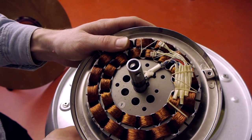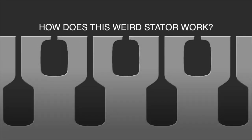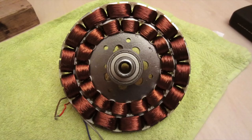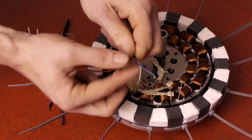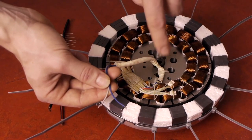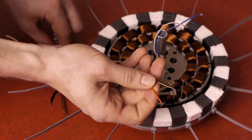What they actually do in a normal ceiling fan is, what's high and what's low on your ceiling fan is dependent on which coil you are actually turning on, which row of coils, I mean. The sequence goes north-south, north-south, and that's good for both sets of coils. Now, all that's needed to make the conversion is you now must put magnets on the outside ring. Now, all you have to do is space them far enough apart. You can put any dielectric material in between, which means plastic, styrofoam, anything like that that doesn't conduct electricity. All you have to do here is identify which wires connect to which set of coils. Again, one was high, one was low on your power when you turned on the fan.